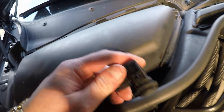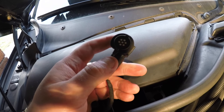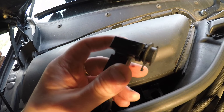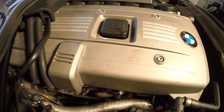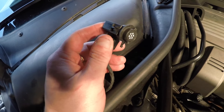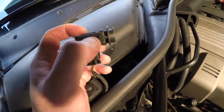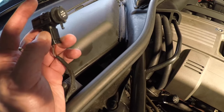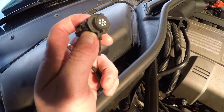So please make sure all three of those things work before you investigate further. Now going back to the AUC sensor in more detail — this sensor not only sniffs the air and directs it to different flaps, but if you've got an oil leak anywhere, from the rocker cover or the PCV, and it detects the smell of oil, it will turn your IHKA off, which is your climate control. It is a very handy device to have working.